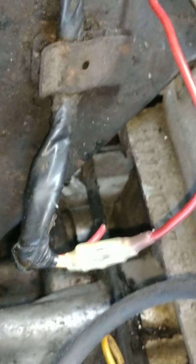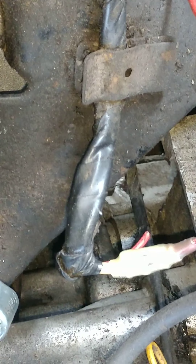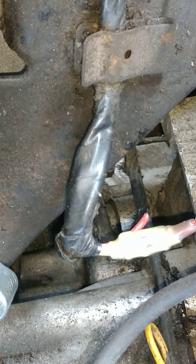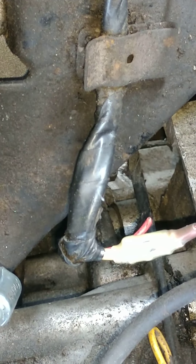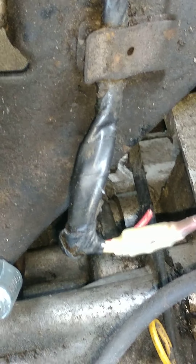Then I have the two wires that originally were there. You have the white one, which is now a red wire — a small skinny wire — that's the one that's going to turn on the light and turn off the light. The other red one was tapped into the generator and just needed a little tiny power. I don't need that wire; I could put it to the back of the alternator as well, but it's just redundant. It's live right now and I've got to tape it up, but it's cut short and not really going anywhere.